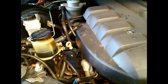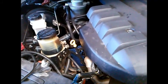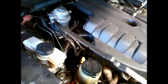I'm going to suck the oil out through the dipstick filler tube — just makes it a little bit less messy. If you haven't got a vacuum pump, you can lower one end of the transmission pan to get the oil out, or use the drain plug bolt. Checking the oil level before we take it out — he's actually got a little bit too much in there, but the oil condition looks okay. Still got that yellowy tinge to it and there's no burnt smell.